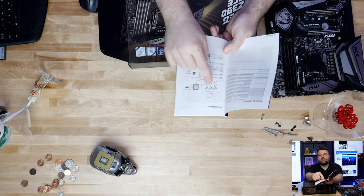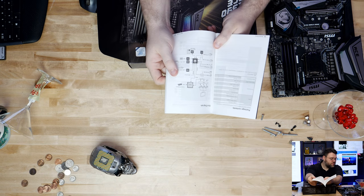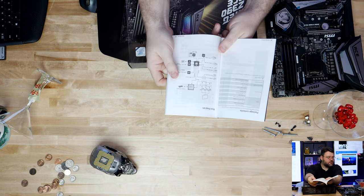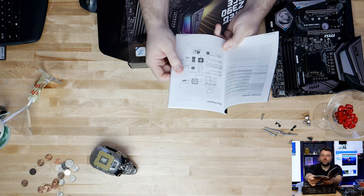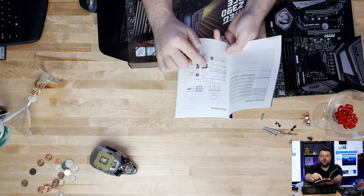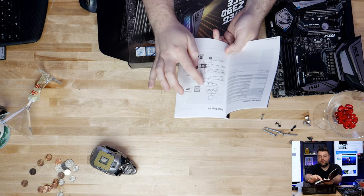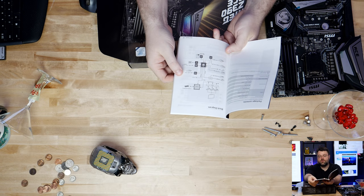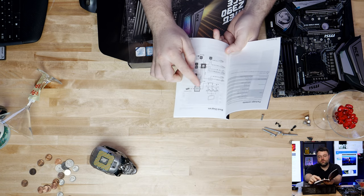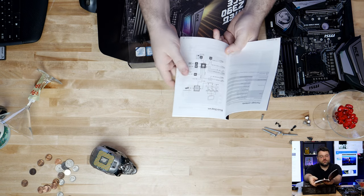Well, the diagram shows that there's a switch with up to three graphics cards, but I'm not sure. Two-channel memory. Our M.2s are all through the chipset, though, which means that they will bottleneck on this DMI 3.0 interface. So if you wanted to run a RAID 1 with two of the Samsung drives, it will bottleneck on this DMI 3.0 interface. But this is promising.